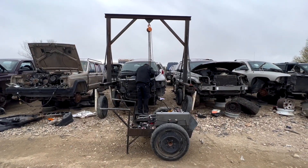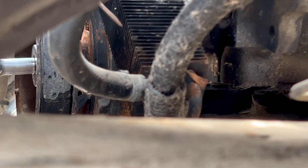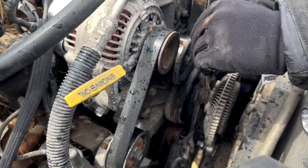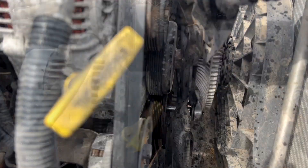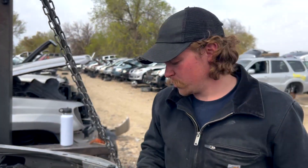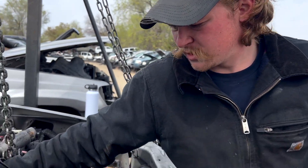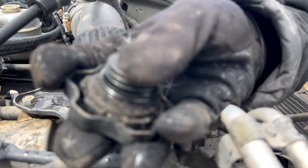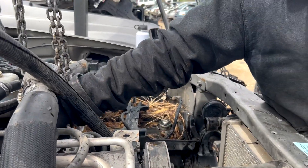Obviously if it's straight water you want to avoid it in a freezing area, and it also makes the interior of the engine rust really bad. I got the fan out of the way — a little easier to get in here now. Trying to get the ratchet on the crank fully. It's definitely building compression — you can see how it springs back. That's a good sign. Another good place to check is the oil cap. On worn out engines you'll see a lot of buildup and varnish on there, but this one looks pretty clean. I think we got a good one, hopefully.